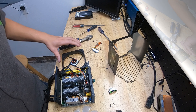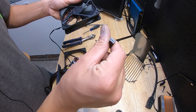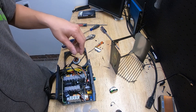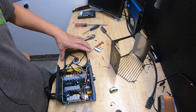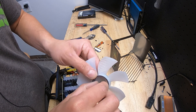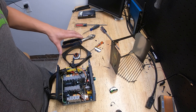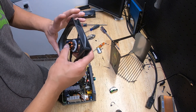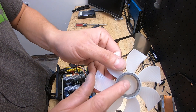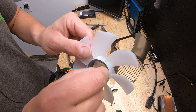Change of plan — I don't have a four-pin fan and this is a four-pin connector over here. After playing with it, this fan actually just pops out — just pull it out. As you can see it has this type of bearing; I'm not familiar with it, but it's pretty dry from what I can see and I think that's the issue going on with it. So what I'm actually going to try to do is grease this and see if that gets rid of the noise — just pack it with a little bit of grease. It's very dry.